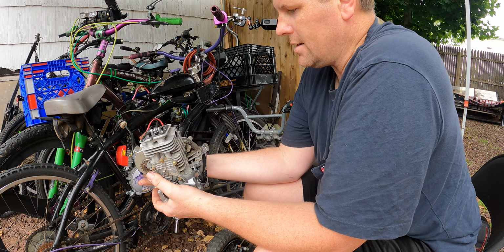So I cleaned it out just a little bit. Same with the exhaust. You can see down in there, the exhaust valve is in already, but see how it's shiny to the left of the magnet sticking down there? See that shiny ring? I put the valve tip, the very tip, in my drill, and I used a 220 grit, I think. I just basically cleaned it all up so it was nice and smooth, nothing catching on your nail.